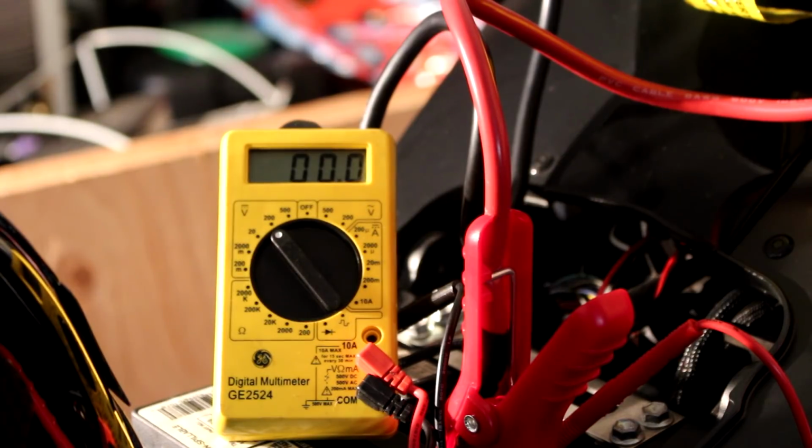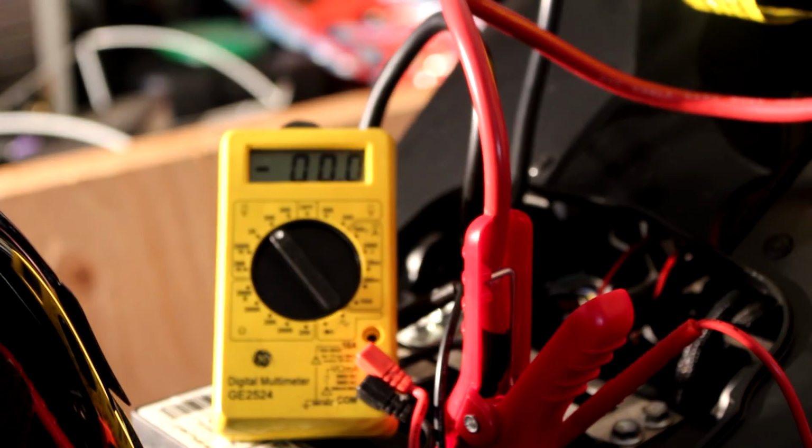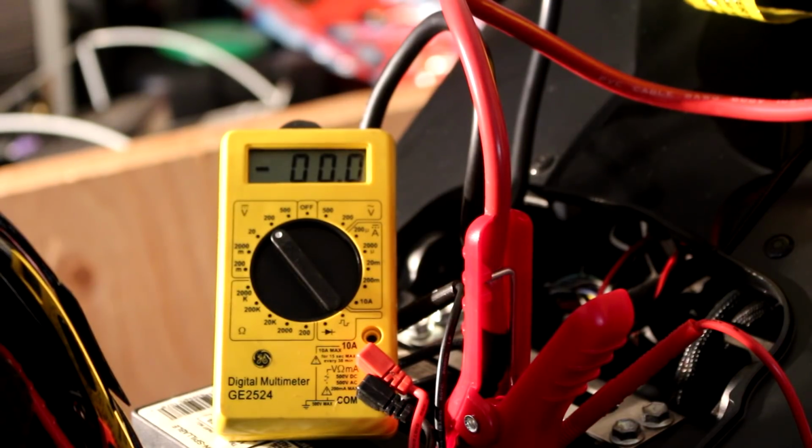So you turn your bike on to accessory, you have the lights on and everything, you haven't started it yet, and you notice that your gauge cluster and your fuel pump isn't as loud or as fast as it usually should be, or your instrument cluster isn't as bright, or your headlights aren't as bright as usual. That means your battery has been drained. There's not the requirement of 12 volts going to those systems.